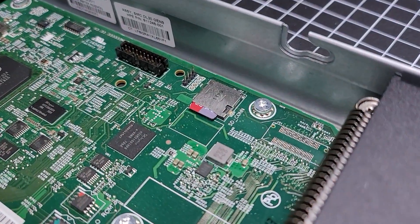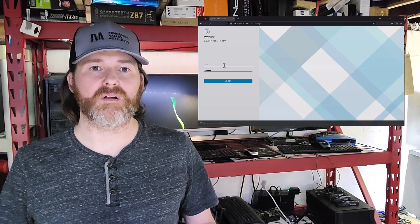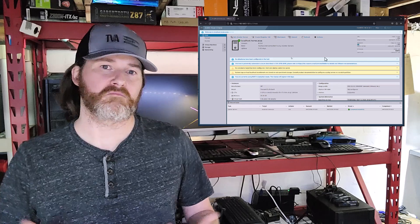Just to walk you through what I did, there were a couple of areas I wanted to test. Number one was if ESXi 8 would install from a USB with no errors, as well as if ESXi could install and boot from the internal SD card on the motherboard. Despite installing ESXi on an SD card not exactly being proper, it worked. It did encounter the expected CPU warning during the install, but it wasn't the one calling out VMware compatibility guide — this one was just a warning about the CPU possibly not being supported in future releases. ESXi 8 installed onto the SD card with zero issues and booted up just fine.